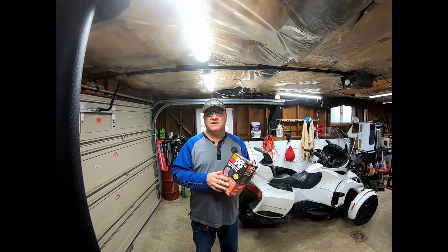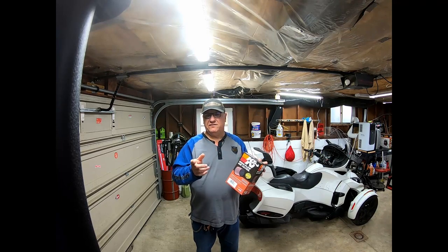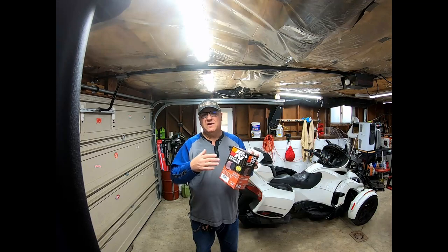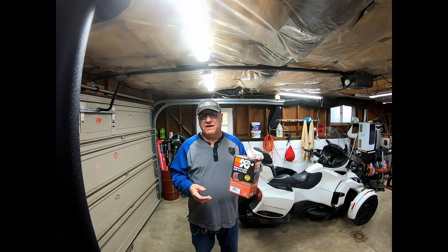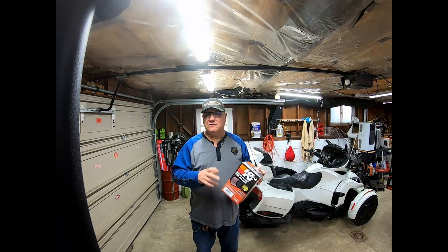Like I said, keep your old filter because when you wash the K&N it takes time — you have to wash it, dry it. I did another video with my Harley on that process. In between, if you want to ride your bike, put the old air filter back in since you've got it apart anyway. In winter you might not need to bother, but it's a handy tip.